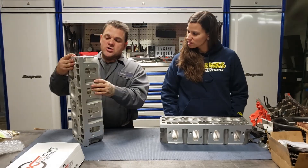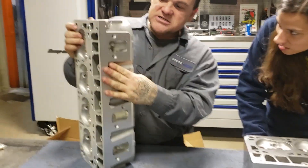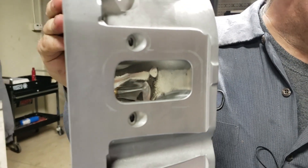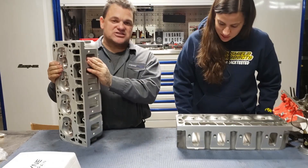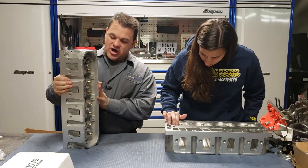As you can see in this port, where the cutter didn't catch way down in the back right here — because they're designing it for shape, not necessarily for size. So the cutter went in and made the improvements it needed to remove and not touch the bad spots, which would make the port worse. Very nice job.